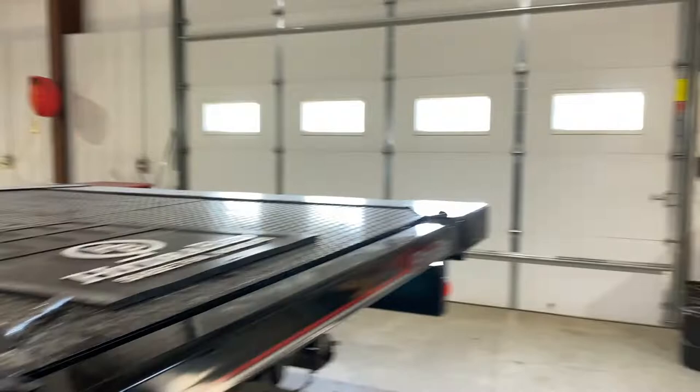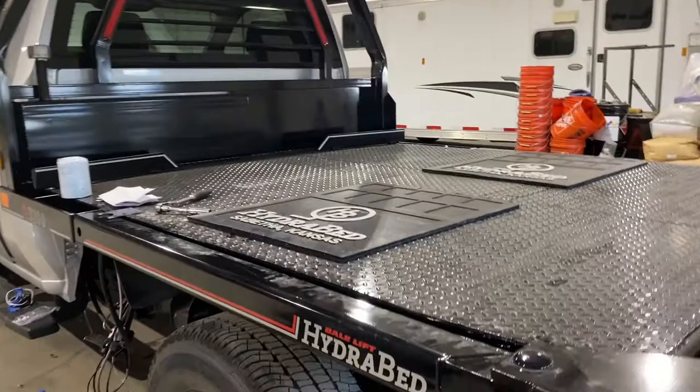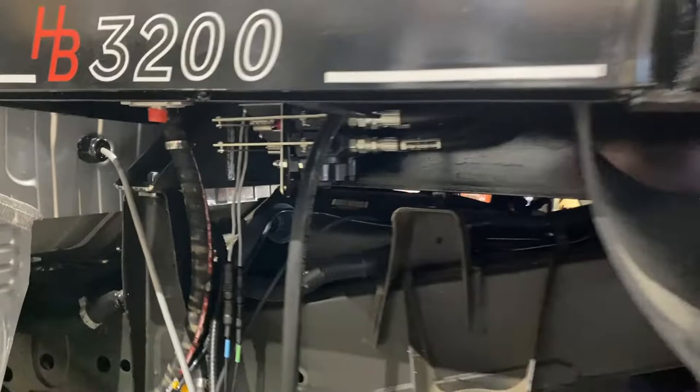One thing that Hydro Bed does is they make all of their beds the same. So depending on the model of your truck, you have to get different brackets for it. These brackets are specific to this truck and they bolt on to the frame right here, then we set the bed up here and weld it onto the bracket. This side has been welded — you can see this middle bracket welds all the way around, back up here to the front. That was a scary weld; it was the closest to the gas tank, and I did not hear an explosion out here yesterday, so it must have been a successful weld.